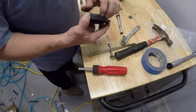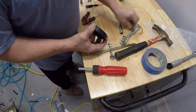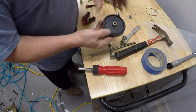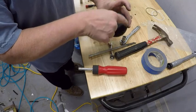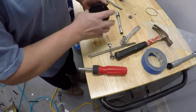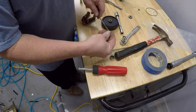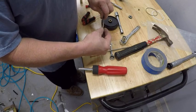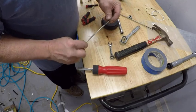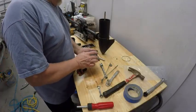Alright, new seals are in. Clean the outer edge — there's an O-ring right there. Take the old O-ring off even though it was still in great shape, and here's the new one — pop it on. That's why this was tapered: it allows the O-ring to squeeze down in there without pinching or damaging it. We'll put just a little bit of grease around this part before we install it. Let's get the bolts ready — I've already taken the old O-rings off. Just slide the new ones over the bolt, turning it as you put them on so it doesn't dig into the O-ring and damage it. Very little grease — you don't want to overdo it.